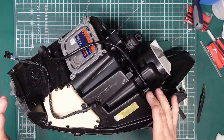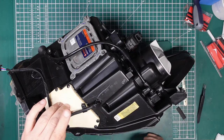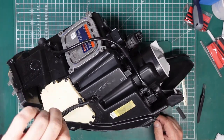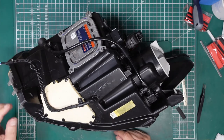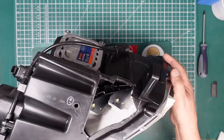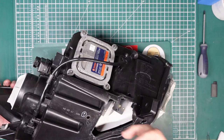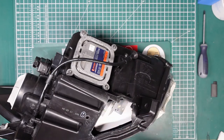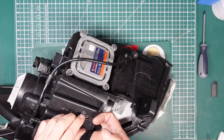Two days later. Here's the finished headlamp — you can see the diodes glued in, the cable coming through, sealant all around it. I've made a hole and fitted a rubber grommet, and there's a p-clip holding the cable so that any pulling lands on the clip rather than on the joint. The cable is also sealed on the inside. My resin moulded blanking plate is on with sealant all around it.